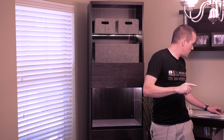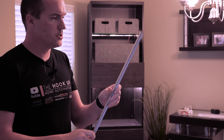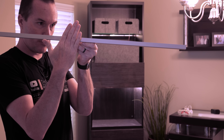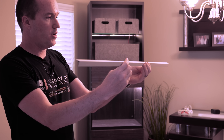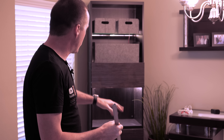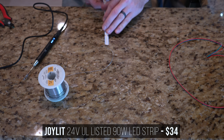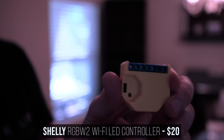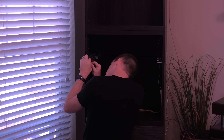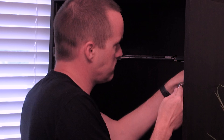We're going to use some aluminum channels — these are 45-degree aluminum channels. What they're going to allow us to do is face them so that this side of the channel is towards everyone, and the LEDs are going to fire backwards. I'm just going to paint these black after I get them cut to size. We'll also use these on the bottom section to make that bottom area look nicer rather than just having the LEDs on the bottom of the drawer slides. I started by getting the aluminum channels painted with a quick coat of black spray paint and soldered some long wires onto my LED strips. I'm going to use the Shelly RGBW2 four-channel LED controller to be able to individually control the brightness of each section. For the middle section, I ended up running the LED strip around the drawer slides like before, but this time I added the aluminum channel on the back, which helps with heat dissipation and gets the strip angled down at 45 degrees instead of just pointing straight forward.